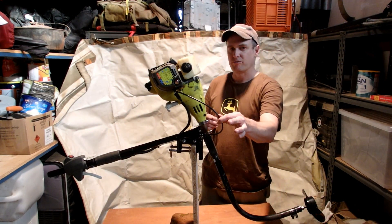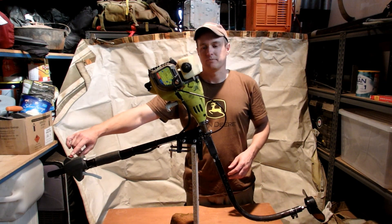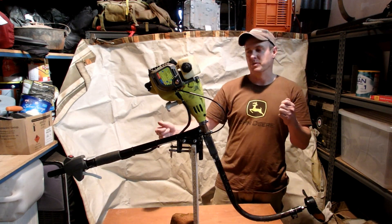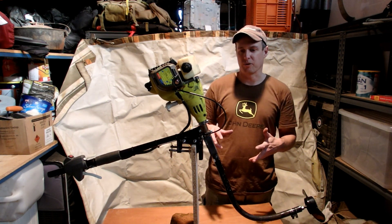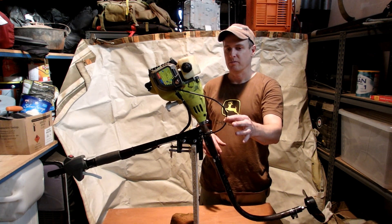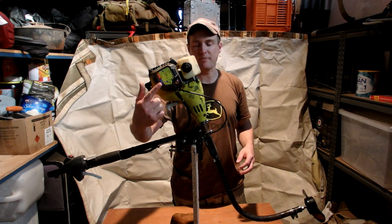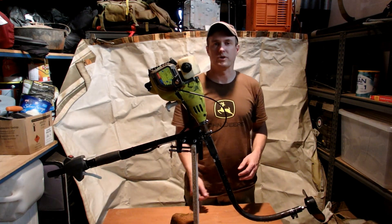One of the other modifications you'll have to make is giving it a longer throttle cable and extending the wires that go up to the kill switch, because of how long the control arm is now. But if you're handy with wiring, it's a simple matter of attaching longer wires and reattaching them to the kill switch up the front. For the throttle cable, I bought an off-the-shelf cable off eBay which was a little bit longer than I wanted, but it works just fine. It's quite easy to slot the cable into the carby and attach it to the throttle trigger up the front.